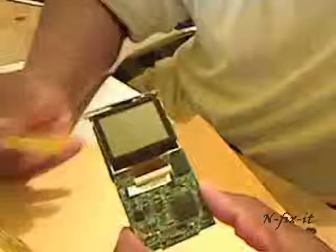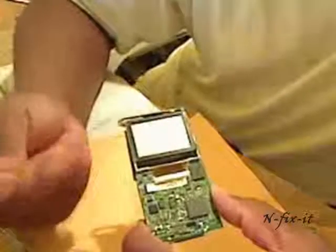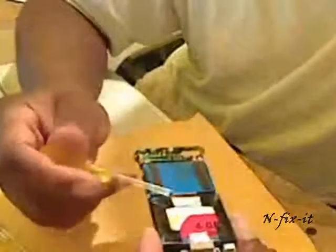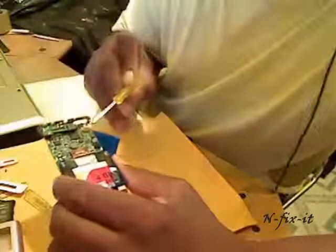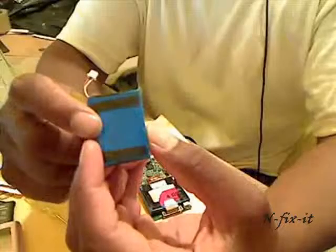Let me give a little overview. Here's your iPod screen and where it connects — replacing the screen will be another tutorial. When you turn it around to the back, you have the iPod battery here in blue, and then the hard drive at the bottom — it's a four gigabyte iPod. Now on the back, the battery has a three-prong connector. Bring it close to the camera — once you disconnect that three-prong connector, be careful not to disturb the motherboard. That's your old iPod battery.